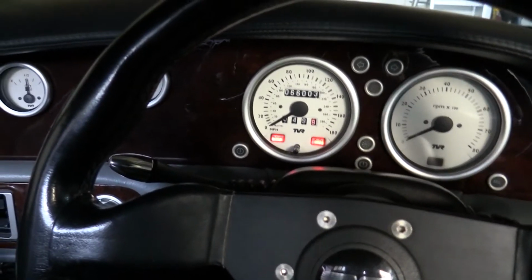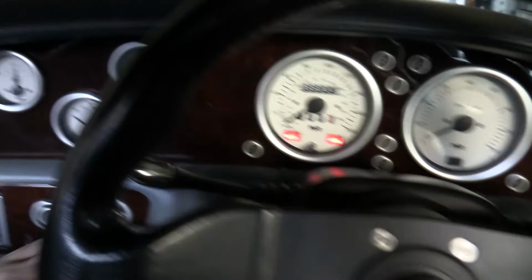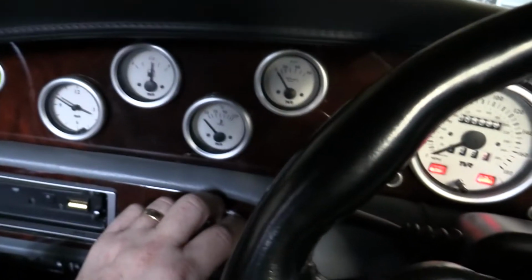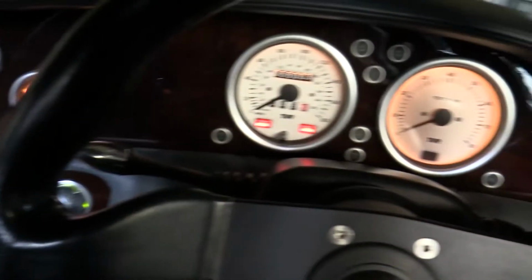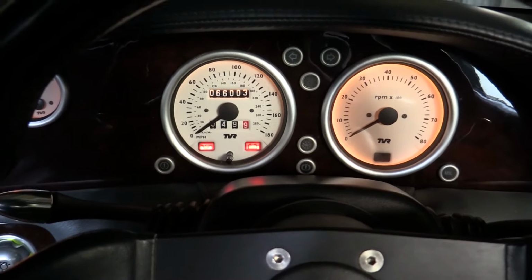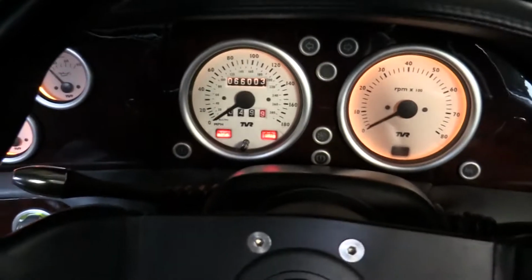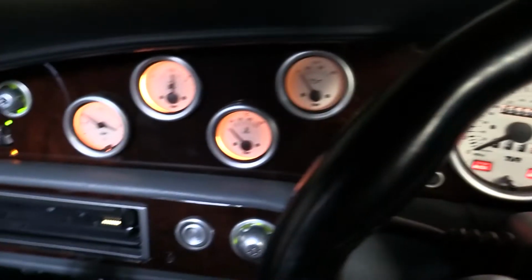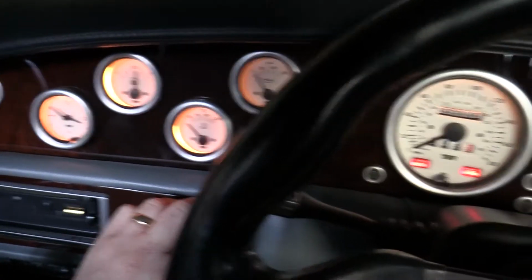Okay, so today's project is a twofold one. First one is I want to change the lights in the dashboard. Put these on. You can see how very orange. These are like normal old filament bulbs, and I'm going to change those for LED replacements. Not only will that make these nice and white, it's going to be less load on the car wattage wise.